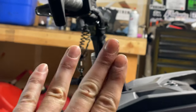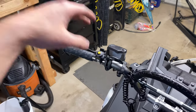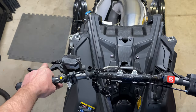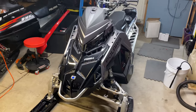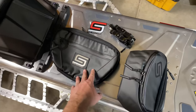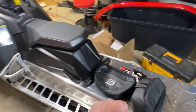Just finished setting up my bars. I like to have the bar in line with the post — not too far forward or back. Personal preference: I like my thumb throttle just a smidge down and my brake lever just a smidge tilted forward so that both of my wrists when I'm on the machine are in a nice neutral downward angle. You don't want them flat because if you crash you're going to break your wrist. I move the brake lever over a little bit and that's about it for my bar setup. The machine is all put back together and ready for tomorrow's ride.